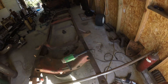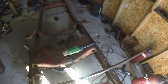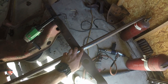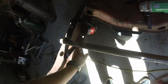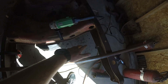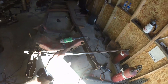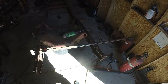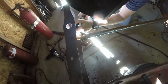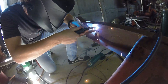We got most of the rivets and the coil bucket off the side, cleaned up most of this side. Now I'm going to support the center of this frame for when this gets cut out. I'm going to take a tube — the measurement I believe is 33 and 3/4 inches, so I measured out 34 inches. I'll cut it big at first and size it down. It goes right across this section of the frame, giving me a nice structural support area. It'll support the frame rails so when I cut this thing out it won't bow in on itself and screw everything up.